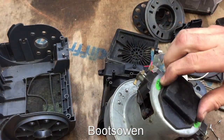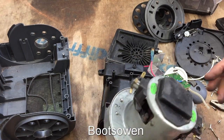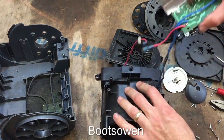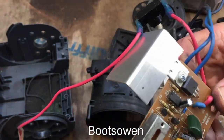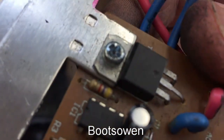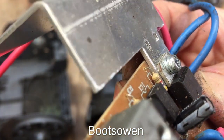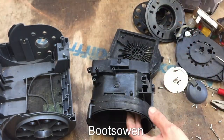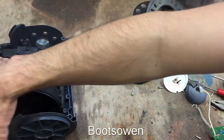It looks smaller than a Henry — Henry's are the ones I've been dealing with recently. 2416 — that would make it four years old, though it looks older than that to me. It's all covered in black, probably carbon dust. There's the board — it might be a TRIAC. Yeah, it's probably a TRIAC. Let's see if I can see what it says there — it's BTA 16. It's got a capacitor on it, big heat sink on that — TRIAC. It's black dust everywhere and just a load of plastic, little springs and whatnot.